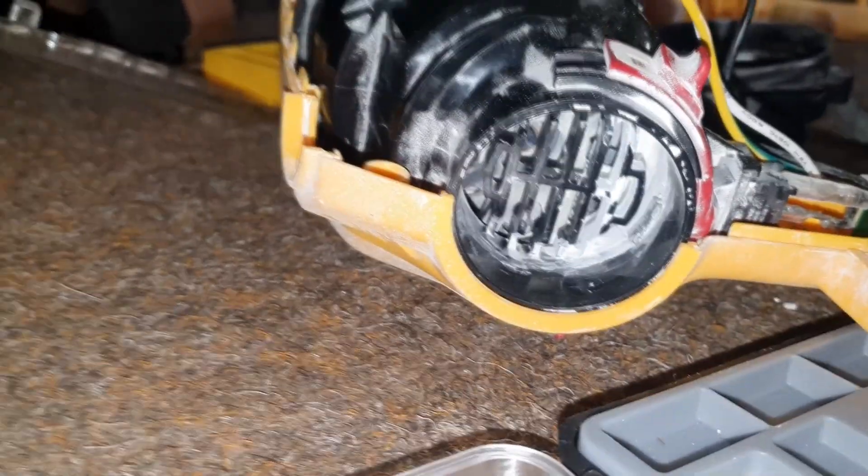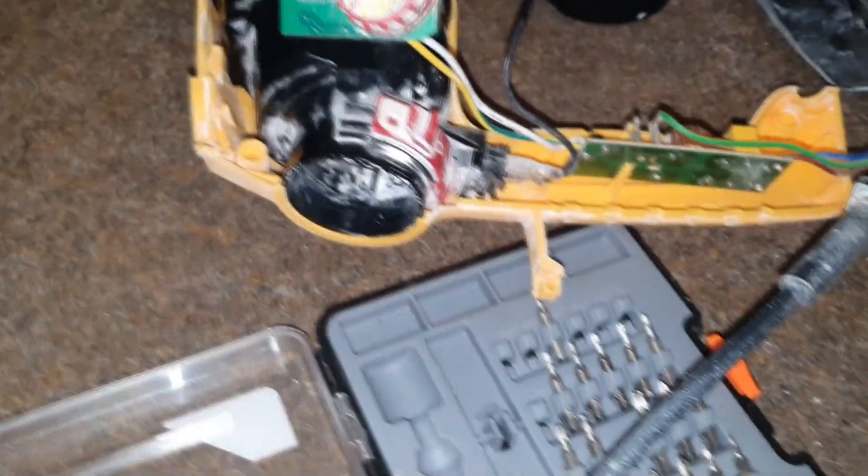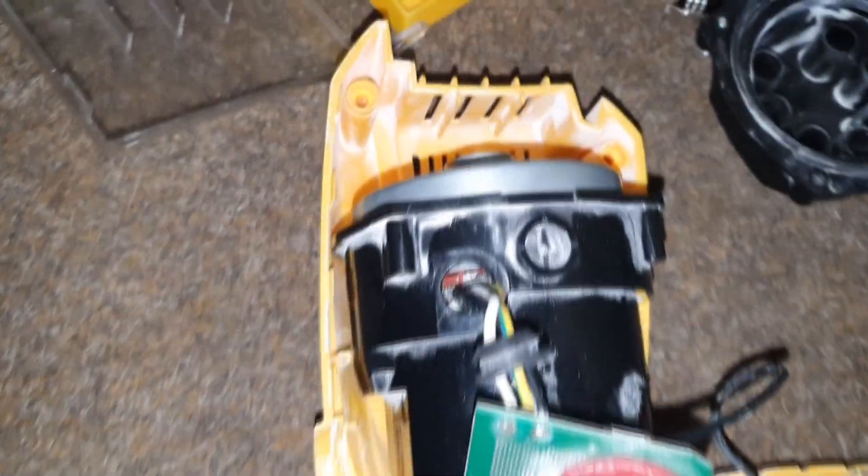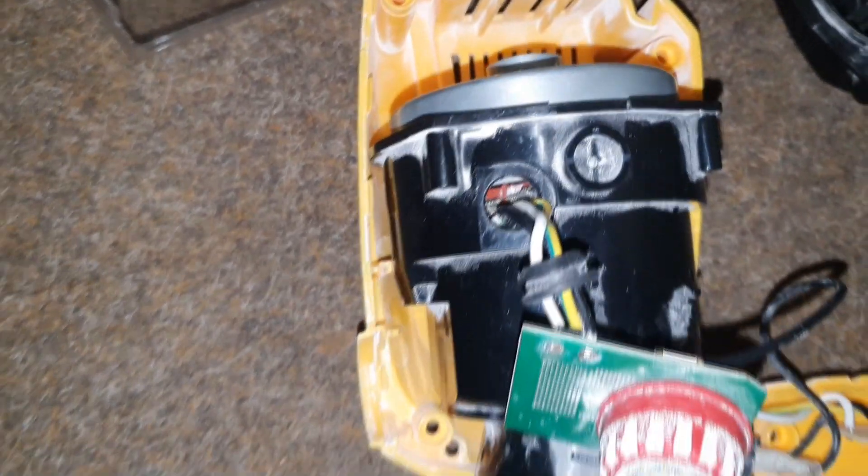So far so nice. Let's put it to maximum — do the same again and twist again. Maybe you can see inside there are some sparks going, but at least it works a lot better than before. So if you have problems with this paint gun — Wagner brand — it is possible to fix the engine. If someone says it's not possible, you're lucky if it's just the brushes that were sticking. Probably don't bother with all the wiring and paint inside there because the worst thing that can happen is it could burn, but otherwise it will be there forever and probably won't bother you.